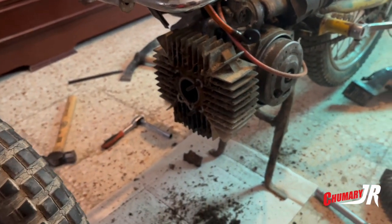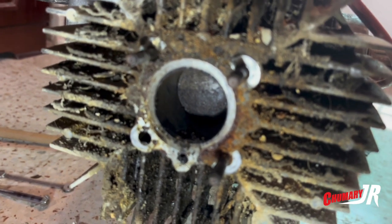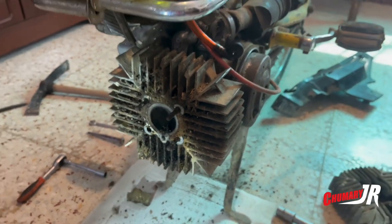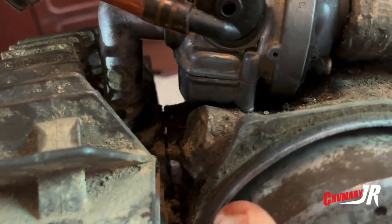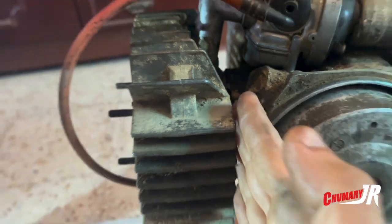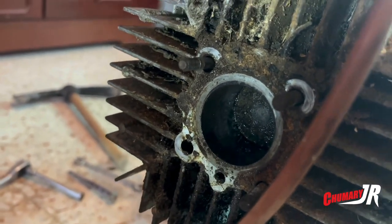Let me turn on a light I have here. Look, you can see — there's the piston. So let's see if I'm able to free the piston. Little by little I'm using it as a lever and getting some movement. I'm inserting wedges here, tapping them gently with great care, to see if I can work the piston out backwards. It seems to be coming out little by little.